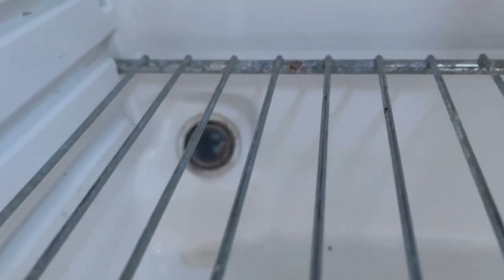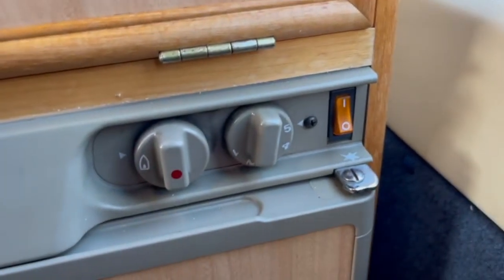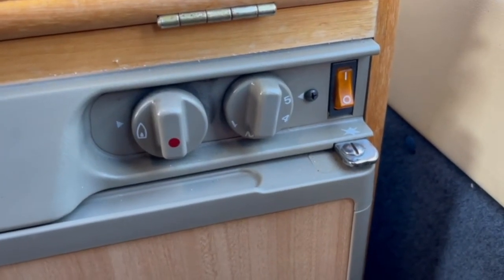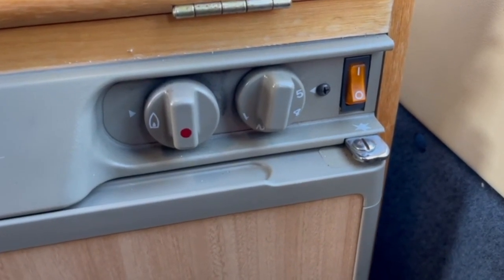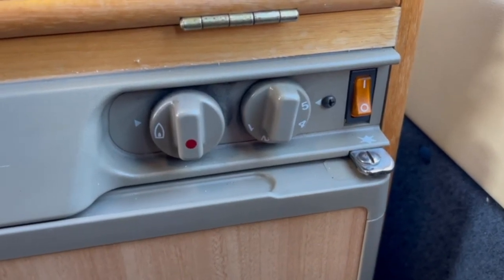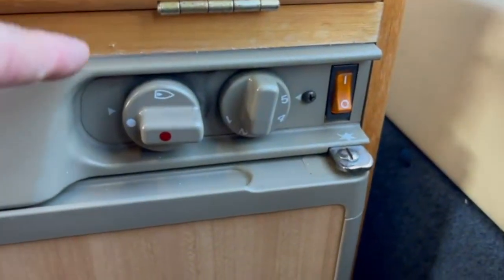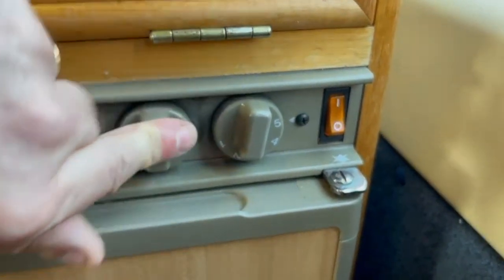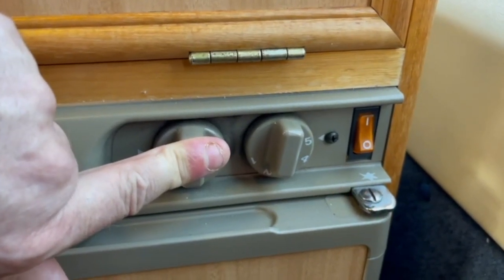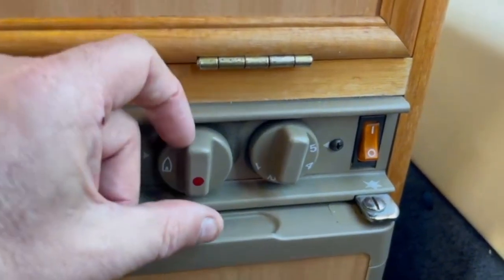You can just about see the blue pilot light — you know it's on because it stops flashing. If a gust of wind blows the pilot light out, it will reignite automatically. I'll demonstrate: turn off the gas, and when it blows out it relights safely. Just hold it in for three or four seconds, let go, and it'll hold. Then switch it off.